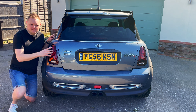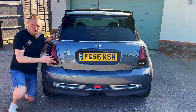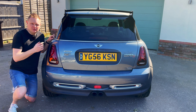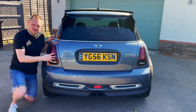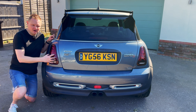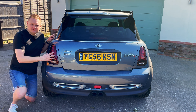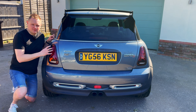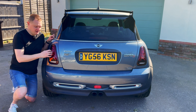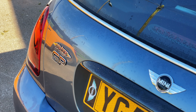I think what I'll probably do is take a look at a facelift pair of lights, dechrome those, and put them back onto the car. But for now we're going to get these removed. The removal process is obviously exactly the same as the fitting process, so if you have the SNPS lights or you just want to switch to facelift lights, as long as they're plug-and-play lights this video will work for you. We just need a 10mm socket — that's it. So we'll get the boot open and show you how to get these removed.